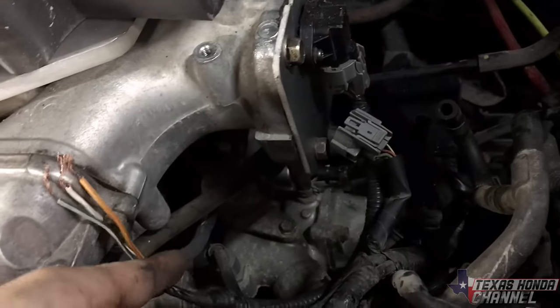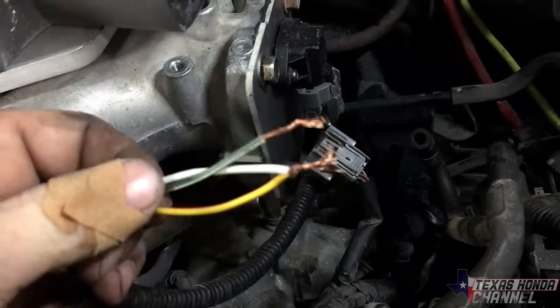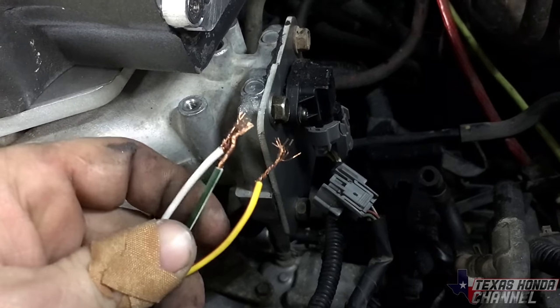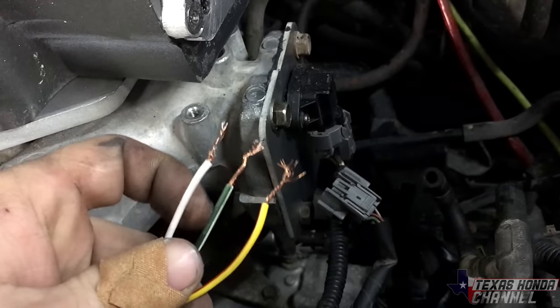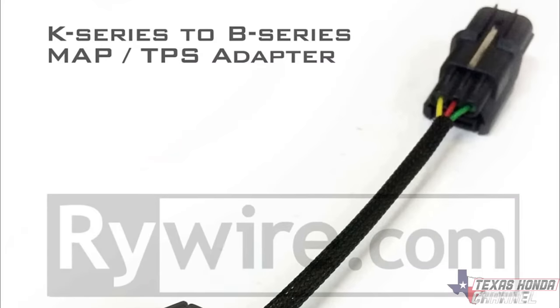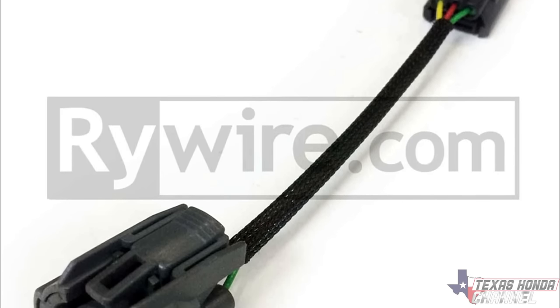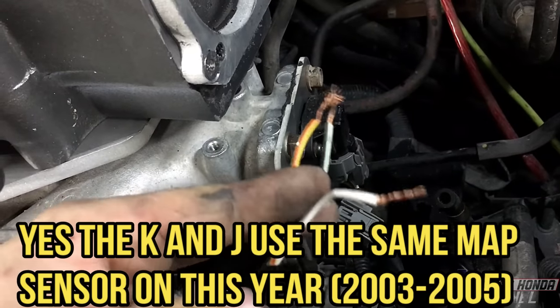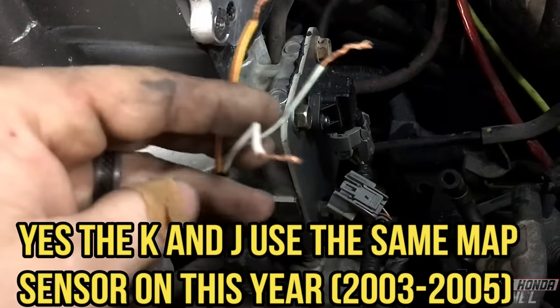The only thing we're gonna have to do for cutting and soldering is the map sensor, which they do make a kit. I'm just super impatient, so I'm gonna do it this way. You guys don't have to cut your harness. They actually make adapters. It's for the K to B series adapter harness, which I'll try to leave a link in the description for you guys. So you can just, it'll all be plug and play and you won't have to cut in your harness.